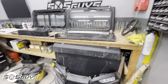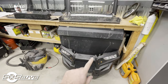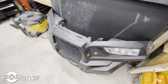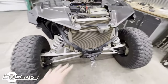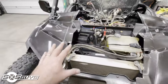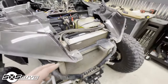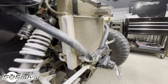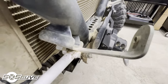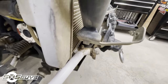I got the Razorback off-road kit off the Razor and the front fascia off. You can probably notice the Corbin Customs turn signal kit — go check them out at corbincustomworks.com. The Razor is now faceless, and I can get perspective on why the hood won't fit correctly. As a post-mortem from our nose dive in Oregon, basically this bracketing got pushed back just a little bit — it's not perfectly straight anymore, so that'll easily get bent back.